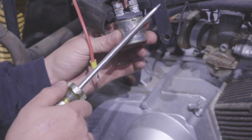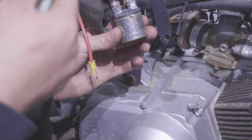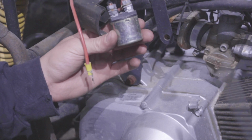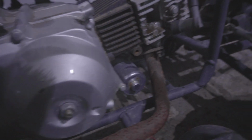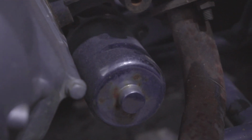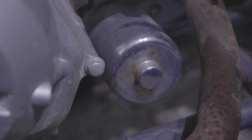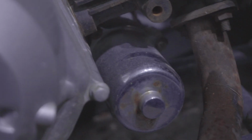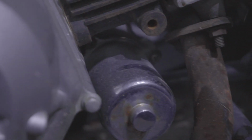And because this isn't functioning properly, that means that the starter button would never work on this wiring assembly, or on yours for that matter, if you're chasing that kind of a problem. We determined that the starter is still good on this particular unit, so I'm not going to replace the starter. If your starter is not good after doing the solenoid test like I just did, I'm going to put a link in the description to a video called how to replace a starter on a Chinese ATV.